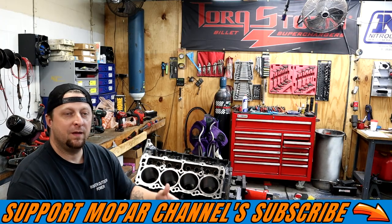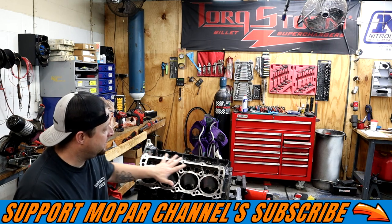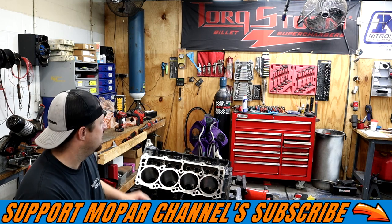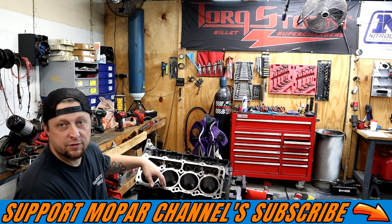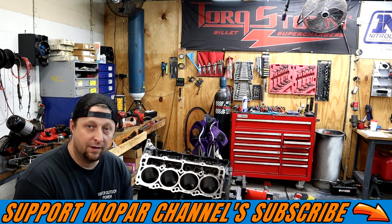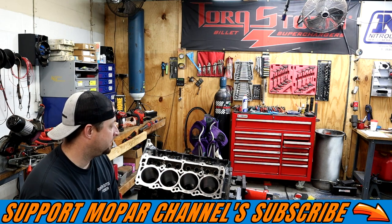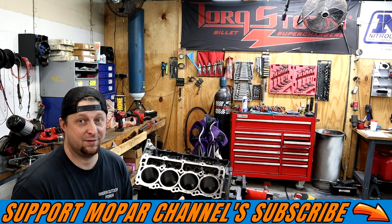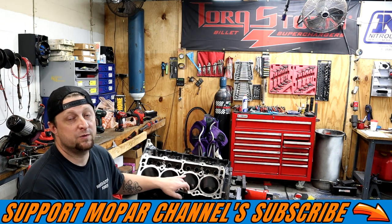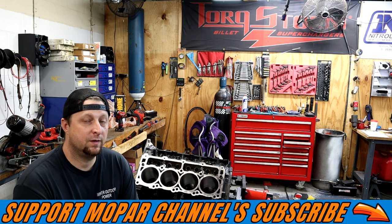All right, Mopar fam. We are done with today's video. As you've seen, we got the head surface cleaned up on the block. We did the oil pan surface. We honed the cylinders and everything looks amazing. These cylinders look literally like brand new. I am super stoked how they turned out. And spent like 10 minutes maybe honing all of them. They weren't bad. I mean, this motor was in really good shape to begin with, so didn't have to spend a whole lot of time doing the honing.